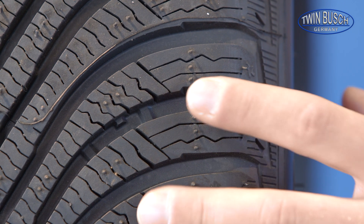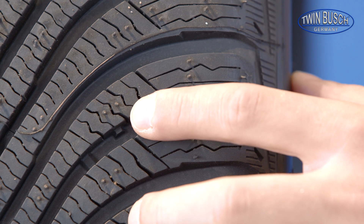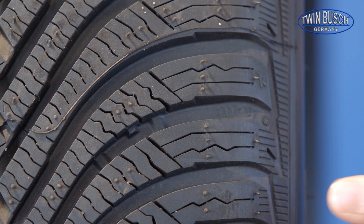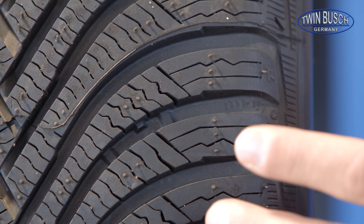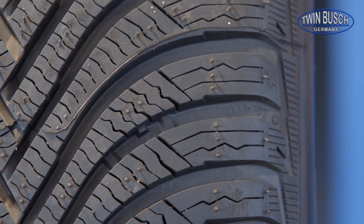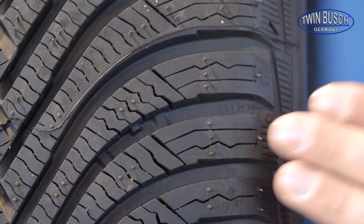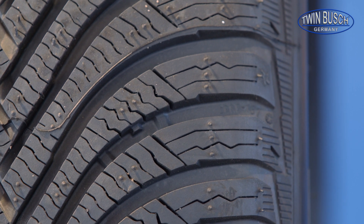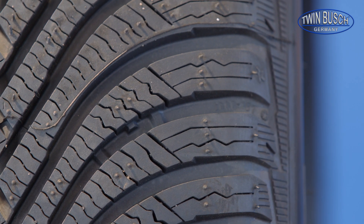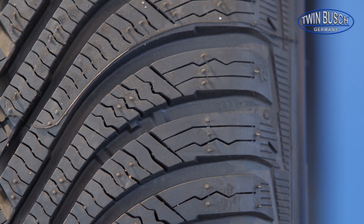In this case we have an all-season tire, which means there is a deeper indicator bar and a higher bar. The deeper one represents the 1.6 mm depth — when this depth is reached, the tire is absolutely unfit to drive and must be replaced. The taller indicator is the winter marking of 4 mm. When wear reaches this marking, the tire is no longer suitable for winter driving and can only be used as a summer tire. At 4 mm, driving on wet streets, snow or slush is not safe, and it is advisable to change the tire early.